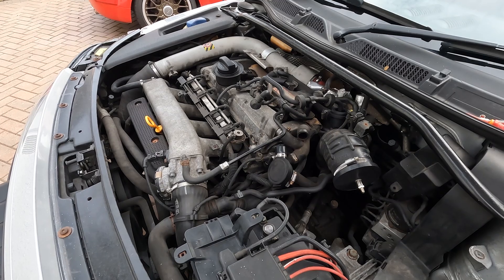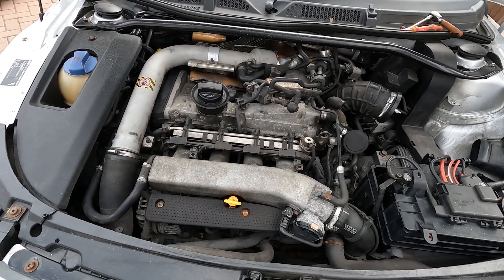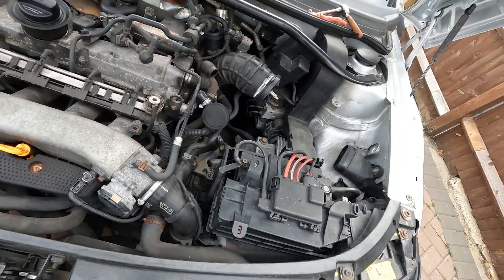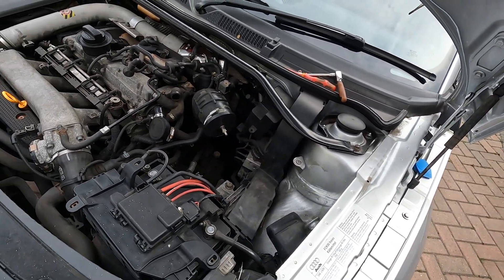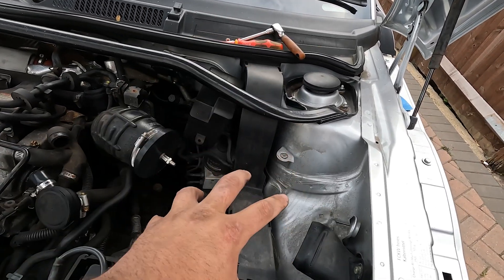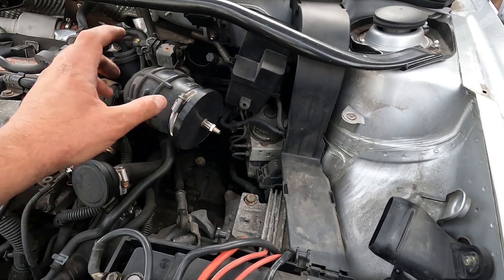So that's how you find a boost leak with a compressor. Basically, that's the process. I would say the easy way is to listen for air — it helps if it's quiet. The benefit of a smoke machine is you can see it visually, but if your hearing's alright and you don't want to buy a smoke machine, then this is definitely the best option. What we need to do now is get a new three-way piece here, then carry on with fault finding to see if there are any more leaks. Remove the airbox and MAF, fit the 80mm bung — that's 80mm on a 225, 70mm on a 180.